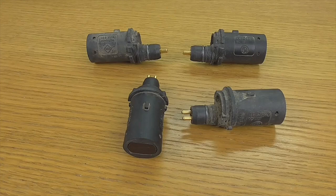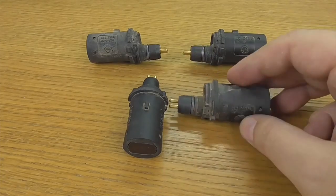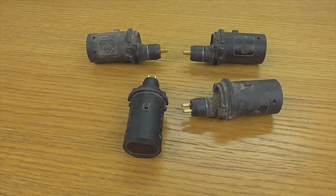Someone told me that with the diagnostic machine there is no error shown for two-pin sensors — the machine does not usually give an error and does not detect it. With three-pin sensors, yes — the error comes out and you can even see which one fails. But for those with two pins, the diagnostic machine does not usually give us the error. I hope this video will serve you; if so, give me a like and subscribe to the channel. Thank you very much.